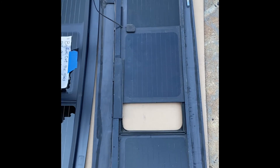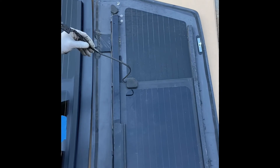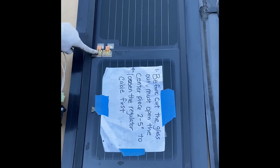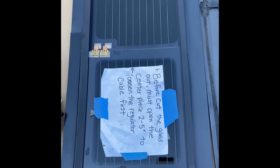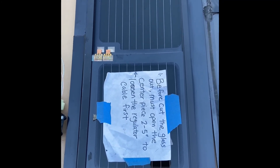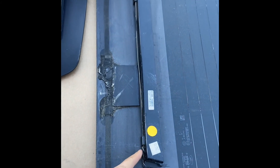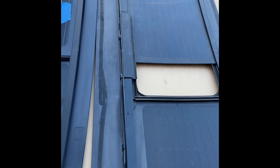The original slider has a short wire that connects to the center piece — that cable is not needed on our slider. The factory one uses a wire to connect power to the center piece, but on our slider the heat connects through the heater element. Once it's closed, it's connected. That little wire is no longer needed. Similarly, the extra cable below the track on the original is also not needed.